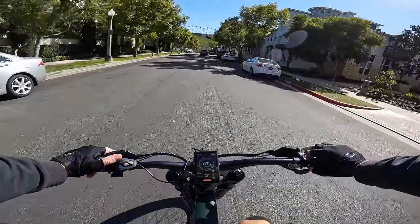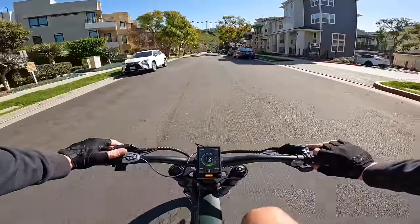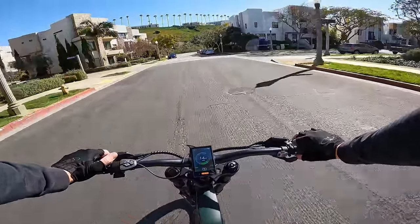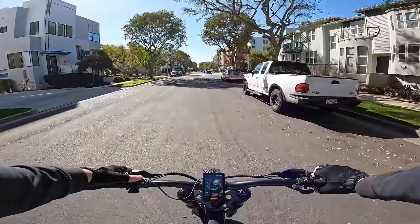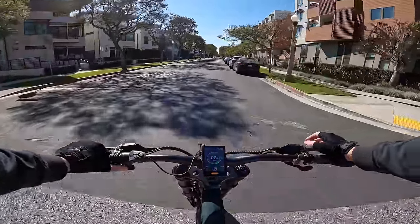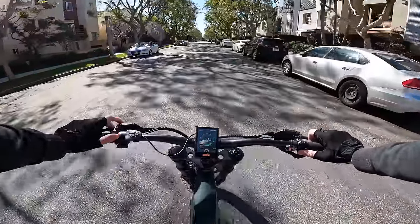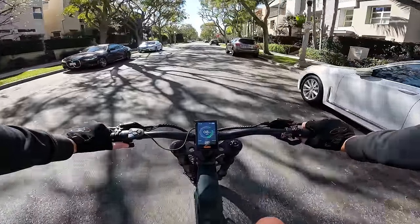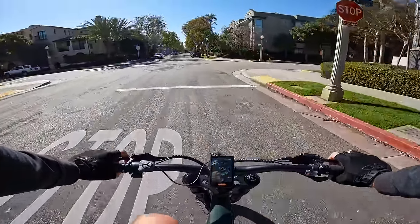Let's try pedal assist three, using the torque sensor, not the throttle — it bumps up the power a little more. Pedal assist four on eco mode bumps it up a bit more. Shifters are snappy and smooth. Pedal assist five on eco mode — this is a great feeling electric bicycle. Bumping down to two and trying the throttle on eco mode level two: it'll peak at 1,500 watts on eco mode, indicated by a green backlit display. Does it cut power when I shift gears? Putting it on four, full throttle eco mode, then shifting — it doesn't cut power, so you could hear the chain pop. You've got to be careful — let off the throttle, cut back on pedaling a little bit when changing gears. You don't want to snap your chain.